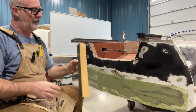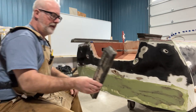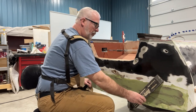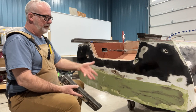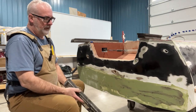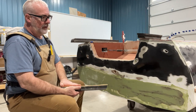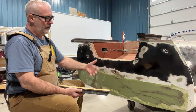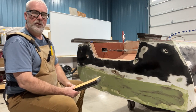This foam has just a little bit of flexibility, but not enough to flex terribly into the repaired space. It's going to give me a very flat surface as I hit just the top of the repair and the bottom of the transom, giving me a nice fairing direction so I can go sideways. This is a very awkward position to work on this transom, so I'm going to be standing up to get a lot of push and pull — almost like a rip saw or cross-cut saw. I'm going to get at that with 80 grit, which is my grit of choice at this stage. 60 I use to grind down; 80 is now used for fairing, and I don't want to get into this other paint too deeply.